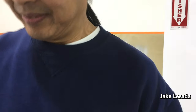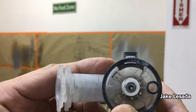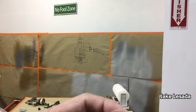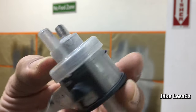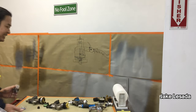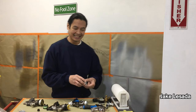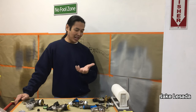The Acu Spray works with an air compressor gun setup and has removable parts. I was trying to dissect the design — looking at the air horn — because I noticed a lot of orange peel on the primer panel when using it. The worst thing in primer work is if whoever primes it doesn't prime it smooth.